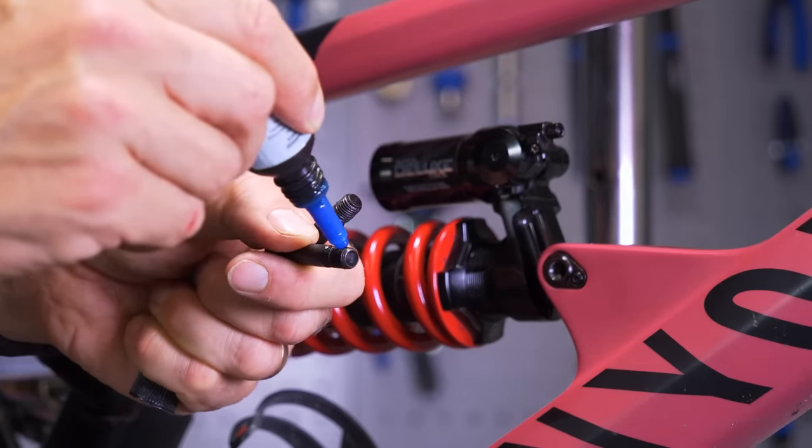One of the whole advantages of having a coil shock over an air shock is that once you've set your rebound damping, it will stay predictable because it's not affected by the heat of the shock as it can be with air shocks. Get that nailed and your bike will feel amazing. So we've got a good base setting for the rebound — of course that might change when you head out riding. If you do loads of big jumps, you might want to add a touch more; if not, perhaps a touch less.